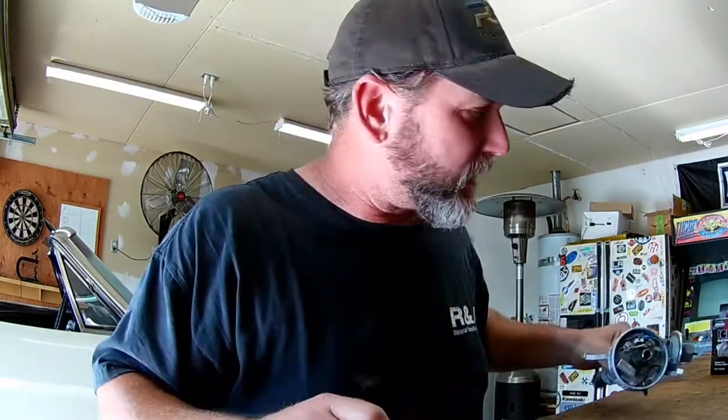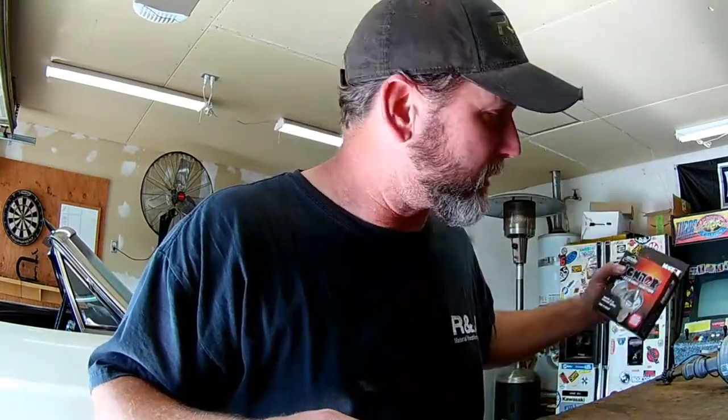That's pretty much going to wrap it up for today — actually for this week — on our 66 Mustang project. I worked on it over multiple days and got some parts in. We went through and changed out the seals on our transmission and changed out the tranny filter. I've got a few more things to do on the tranny before I can bolt it on the back of the motor, close up the motor, get all that bolted back together and slam that whole assembly in as one piece. We're making good progress. The distributor currently has points and a condenser — we're not going to be using those; we've got a nice Pertronix electronic ignition that's going to replace all those components. Pertronix is great — those EIs are super reliable; I've never had a problem with any of those Pertronix ignitions running them in lots of hot street cars.